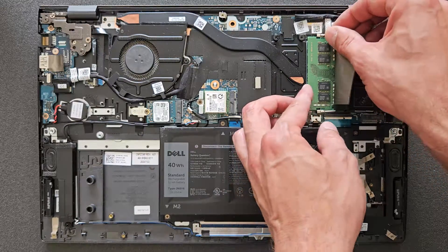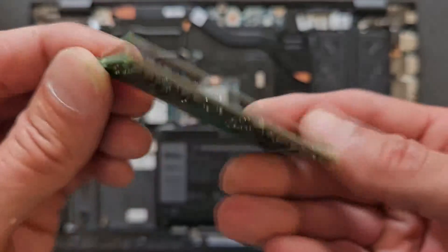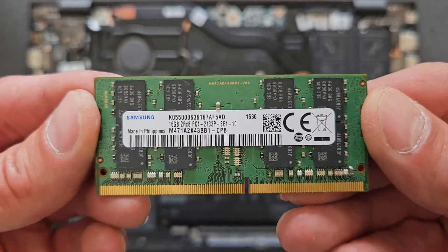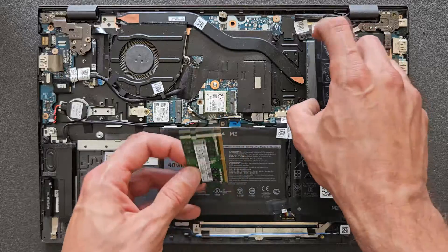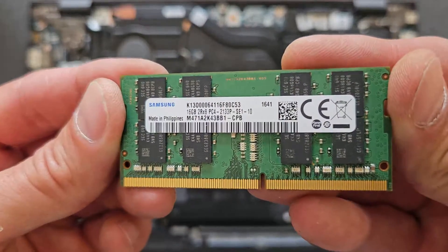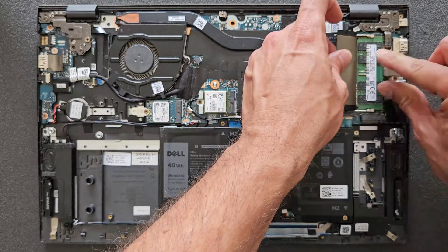Okay, we're gonna remove the RAM now. I do recommend disconnecting the battery before you upgrade anything, but I didn't do it here. So that's your RAM number one - at the moment it's eight gigs DDR4. I don't have the same speed of RAM so I'm gonna install a bit of a lower speed, but still it's gonna be 32 gigs. I'm gonna leave links in description for faster RAM so you can purchase it - it will work, I just didn't have faster RAM. Okay, 16 gigs will go in - that's one RAM upgraded, and that's the second one now. There it goes and RAM upgrading is done - that's 32 gigs.